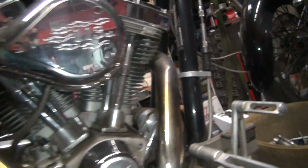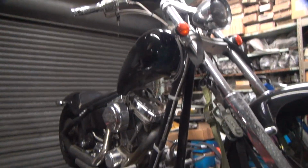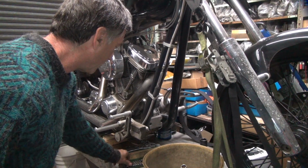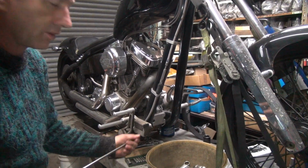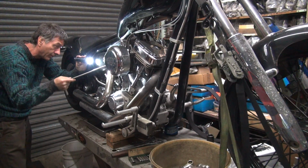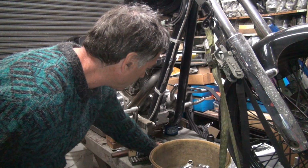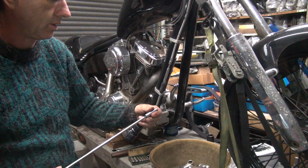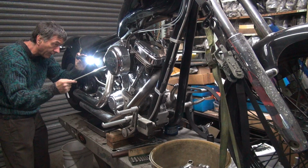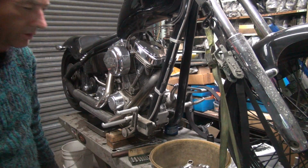You got some kind of small diameter nut on there. Some kind of metric nut. Who knows what they got on this bike. This thing's been worked by so many people, butchered this thing. I don't know what the hell you got for hardware anymore. Okay, so it's not 1/2 inch, not 7/16, and it's not 10 millimeter because that's too small, I think. So what other metric tool can we use?